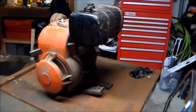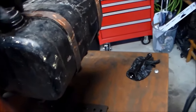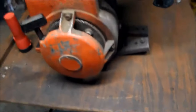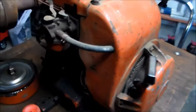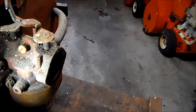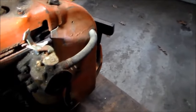They say it ran. If you spray some ether in it — I have no interest in doing that, I'd rather just get it running right. It feels like there's very little compression. It does have spark. Something's hanging up in the recoil — dogs are slipping, or it has one of those anti-kickback things. I'll start tearing into this pretty soon. I just want to get a pre-teardown video. I'm not sure what kind of carb this is or what model numbers are on it. I can see a 240 on there.